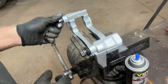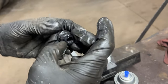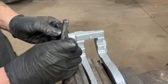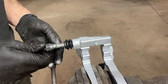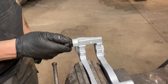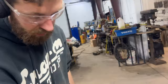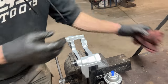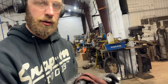We've got some lube on these pins — not a whole lot, just enough. We've also reconditioned the rubbers so they're nice and clean with fresh lube. The bores of the caliper adapter brackets have been cleaned, and we just slide the pins in. They move nice and freely. I'm putting some grease around the ends of the pins because they are bare unpainted metal. We've got our caliper brackets all painted up and we'll stick the clips in.